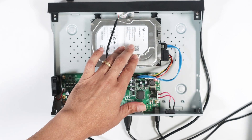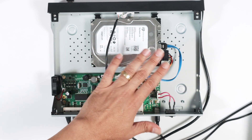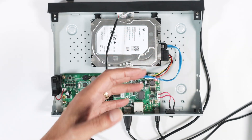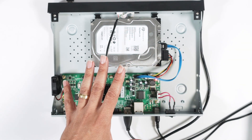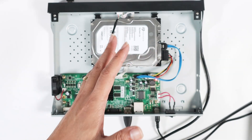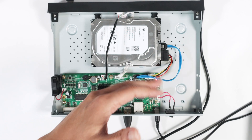It's important to have the correct hard drive for surveillance cameras. In this case, Seagate Skyhawk Lite. I can also use Western Digital Purple. Don't use hard drives for PCs — they don't work well with surveillance systems. Be aware of that, make sure you have the correct hard drive, otherwise you're going to lose data and lose recordings.